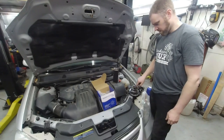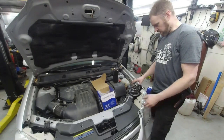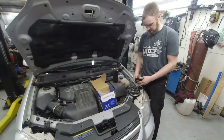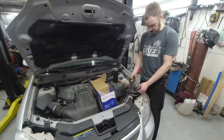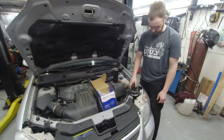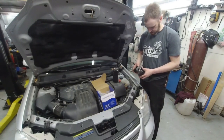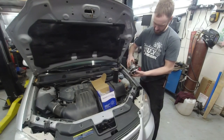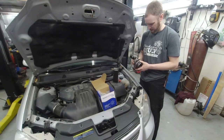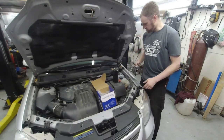You see the grooves in there? That's the magnetic pickup area. If you have that exposed where dirt can get back there, hopefully the axle seals it up pretty good — but there's a good chance dirt will stick to that magnet and mess up the sensor's reading ability over time. The bearing itself is pretty lightweight and chintzy, with open air gaps surrounding it. So it's not exactly the highest quality product.